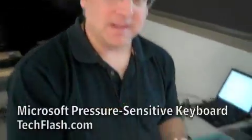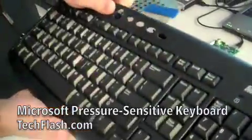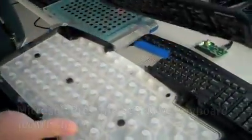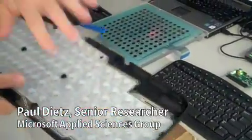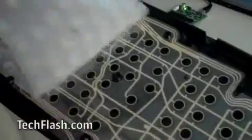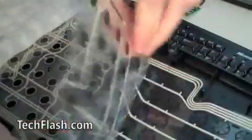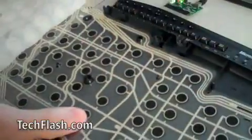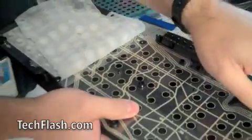This is a pressure sensitive keyboard. I have it unscrewed so you can take a look. It looks almost identical to a standard keyboard — you still have the same silicone domes on top, and three sheets of mylar just as before: a top layer, a bottom layer, and a spacer layer in between with holes, so that when the key comes down, the nub and the silicone presses down and forces the top layer to touch the bottom one through that middle one.